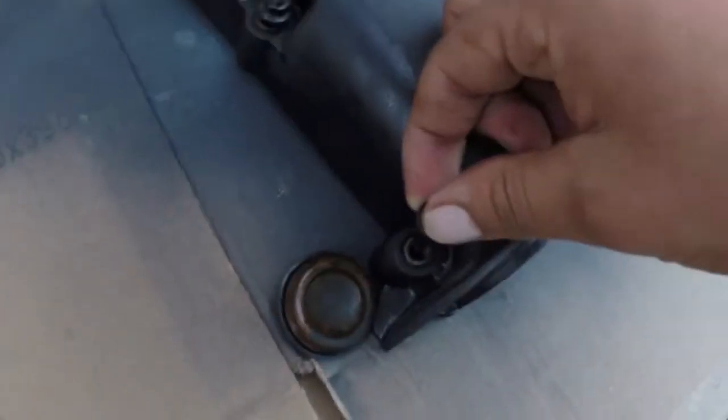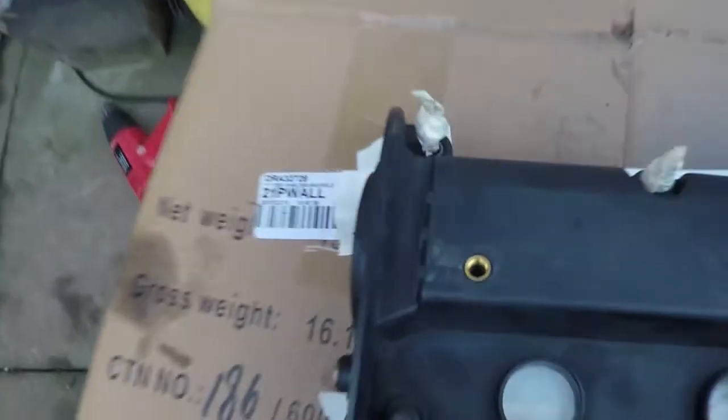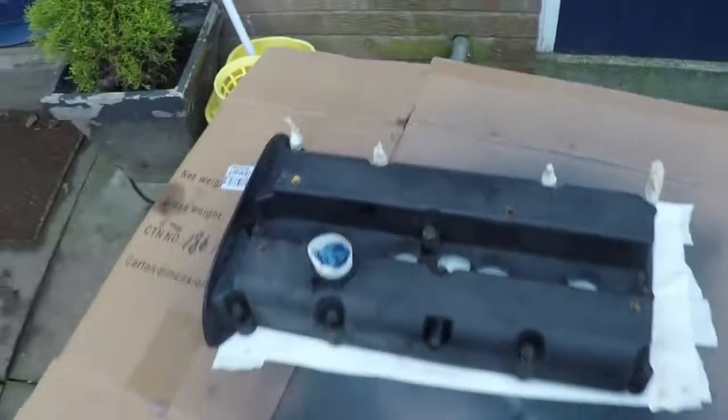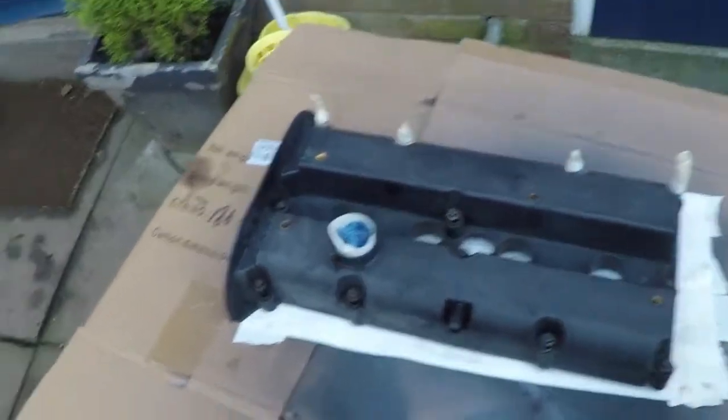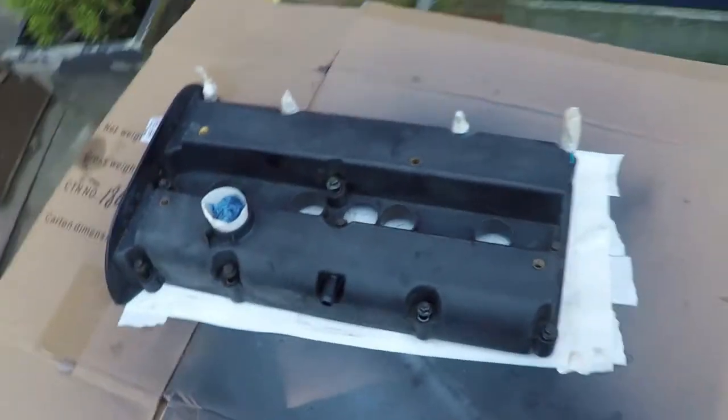I have tried to take these bolts out but I can't, so I'm just going to mask them up. One more clean up and a bit of a sand again - it's not too bad, I've got quite a good surface to paint onto. The next thing is to try and mask around these and raise them up so I can paint the whole rocker cover and not get paint on the bolts. Some I decided to mask up because they are literally just shear bolts - they're at the back anyway so you won't see them. But the ones you will see I'm going to spray over and just be a bit more gentle when tightening them down.